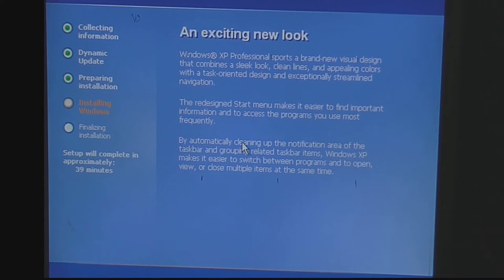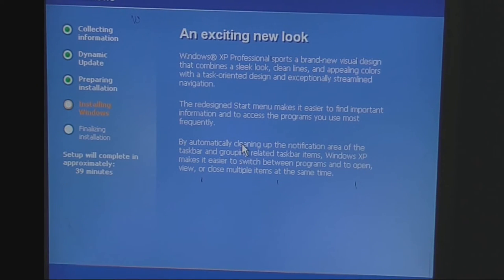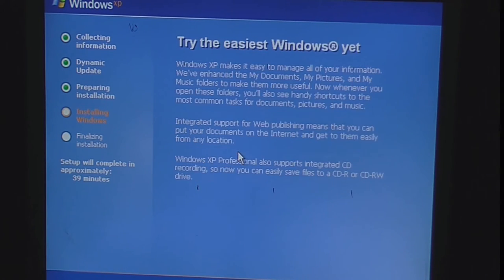We're well on our way now. At first, the Windows XP installation would not respond to my keyboard — as it turns out, it doesn't like wireless keyboards. It works all right from a wired keyboard, though. Here comes Windows XP. I don't know why the fans have come up so high — surely it cannot be that hot. There's barely any heat coming out of that at all. I found out why this thing kept blue-screening every time I was trying to load the previous version of Windows: it's got the two partitions of the hard drive mixed up. Going to reinstall Windows is going to sort all that out, which is what I'm doing now. And we're done.